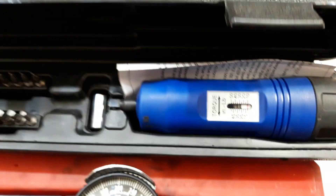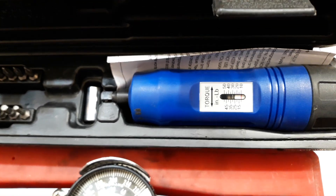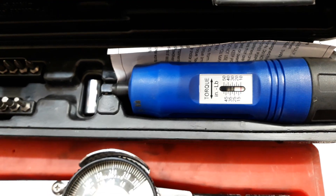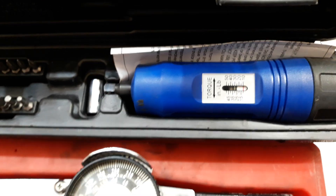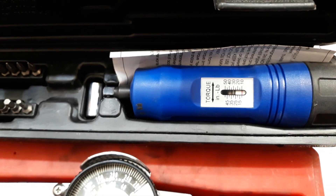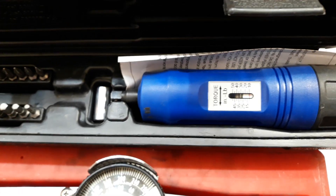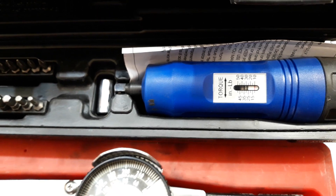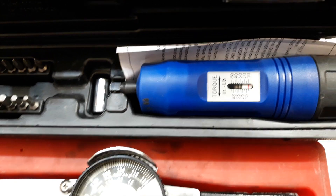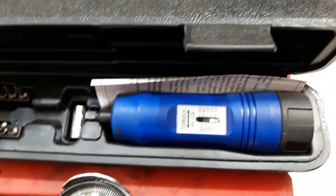One perfect example of why I bought this: hose clamps. Especially right now going into winter, we have a lot of cold leaks. What I do is grab this, torque it to spec, then pressure test it. If it holds, it's good. If it doesn't hold, we're replacing the hose. Yes, I could turn it more until it quits leaking, but the problem is it'll split the hose, or the clamp will strip on the customer when they're going down the road — and then you've got a bigger mess.